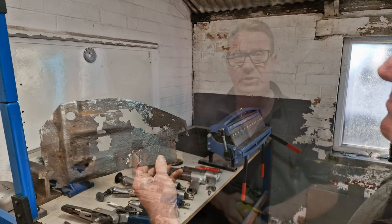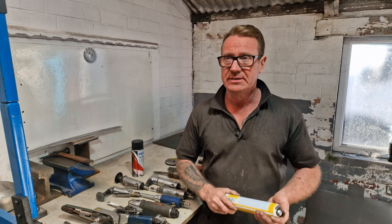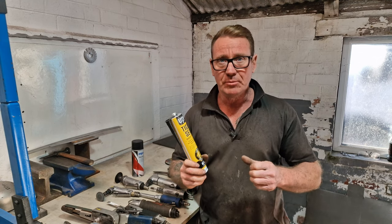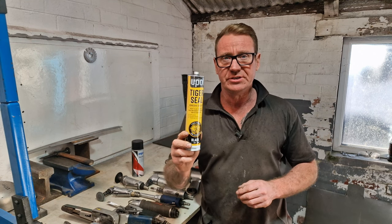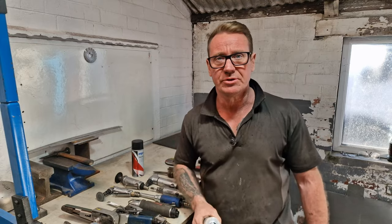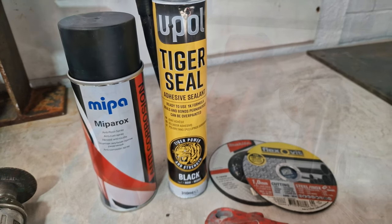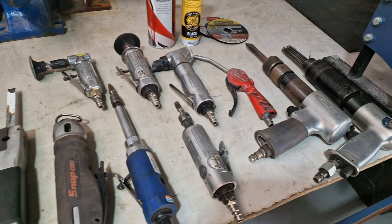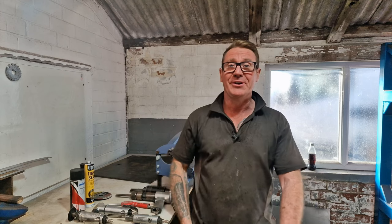From there you can put a coating over the top to stop it dead in its tracks. We also get asked a lot what sealant we use. Our preferred sealant — we can't always get hold of it from our tool man, so we sometimes use a cheaper alternative that's almost exactly the same — is for sealing welds, small holes, and pinholes between welds to keep water out. We prefer this one, but for that job you can use the cheaper one. Just seal over the top of your welds with U-Pol Tiger Seal — fantastic product. That's it for this video, guys. Thanks for watching — if you enjoyed it, leave us a like and smash that subscribe button. Until then, we'll see you in the next one.